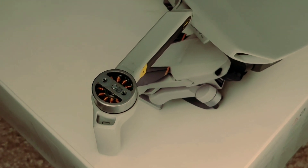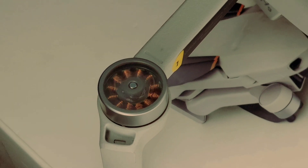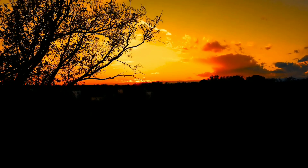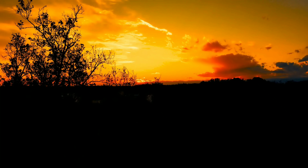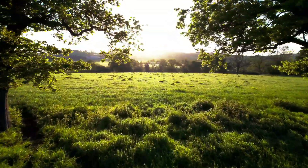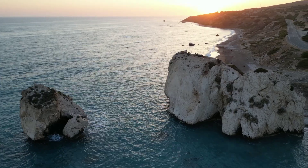In terms of caring for the motor of your DJI Mini SE, it's very important that you store your drone so that small particles like sand or other small pieces do not fall into the moving parts of your motor. Even a grain of sand would cause a lot of problems for the rotor to turn, given that the gap between the stator and the magnets in the rotor is very, very thin. Make sure your drone is stored inside a bag specially designed for it and that it's very clean. Inspect your motors every now and again to make sure everything is okay. Brushed motors are normally louder, create far more heat, and are not as powerful as the brushless motor, so it is better to get a drone that has a brushless motor.